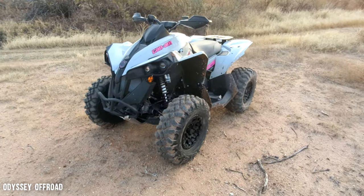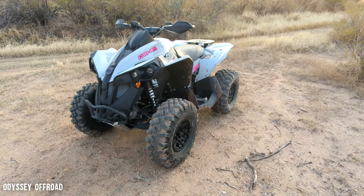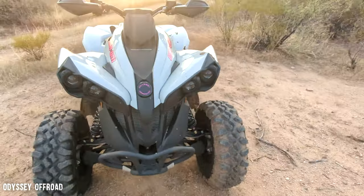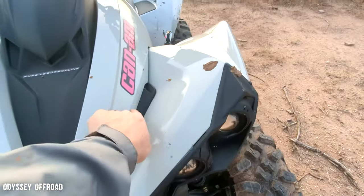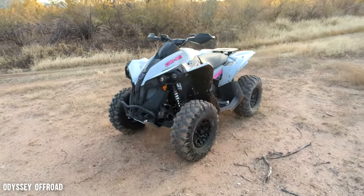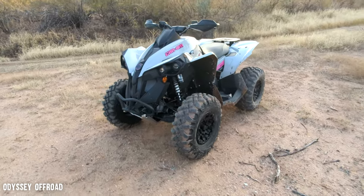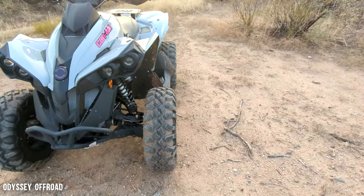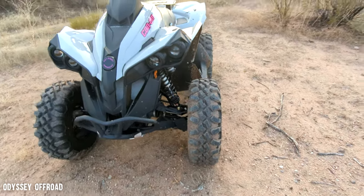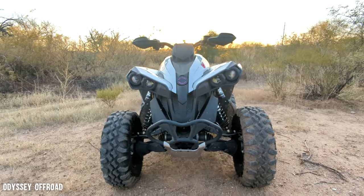You've got a deeper channel in the tire for the bead, so you've got some bead protection. If these were standard non-beadlock wheels the rim would be completely inset. Beadlocks do stick out a little bit, but you've got way more protection now than with the stock tires — the beadlock rings would scrape up super easy and clip rocks. These tires are going to offer way more protection. We'll see what happens with tire pressure — maybe leave it at 7 for a while. I just noticed the hood isn't on correctly — one thing about these Renegades, getting the hood on and off is a pain in the neck to check the air filter. Two thumbs up on the tires. Look at that stance — what a difference.